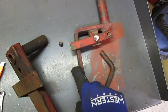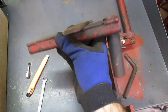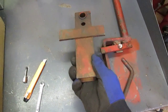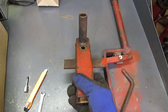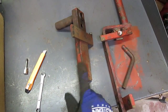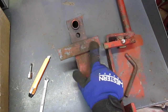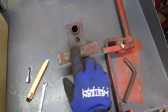The other thing I picked up from him was a rear hitch. Now, this rear hitch is for a 1957 — this is not a 56 hitch. The way we know that is this one is made out of basically sheet metal; that was the standard 1957 design. The 56 version, or the early 55 into early 56, would have been made out of band iron — a side piece of band iron, top, bottom, and the other side, so four pieces of band iron welded together. It probably would not have had this stabilizer, which came a little later in 56, so an early 56 probably wouldn't have had this.